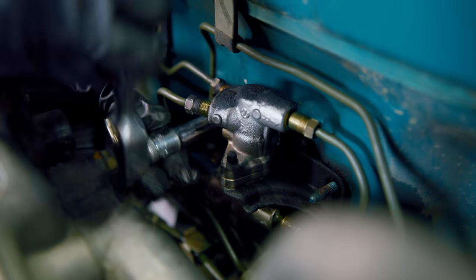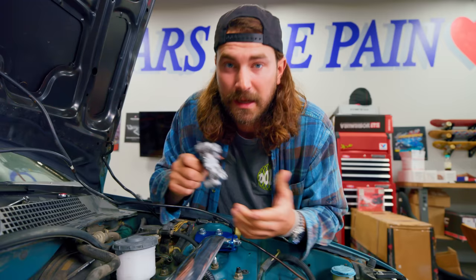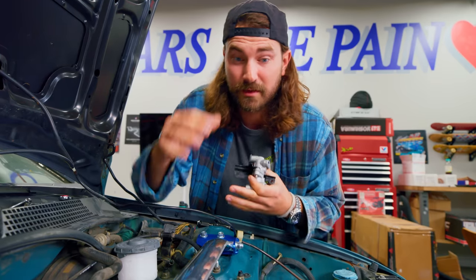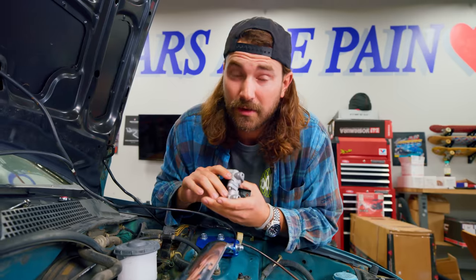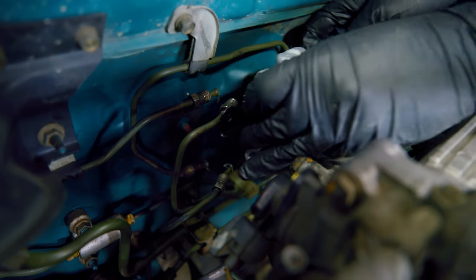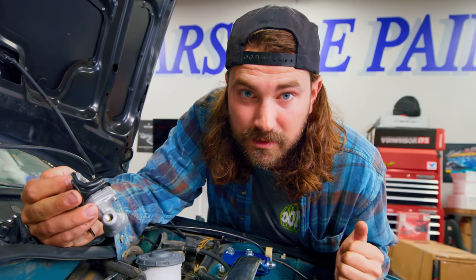While we're at the rear finishing installing the new disc brakes, Hebra was up front pulling out the old proportioning valve, and this is our new one. The proportioning valve proportions the amount of brake power that goes to the front versus the rear brakes. Since we have disc brakes in the rear now, we're going to want a little more juice going to the rear. This proportioning valve is from an Integra that had disc brakes to begin with. We'll put that in, throw some fluid in it, bleed it, and hit the streets.